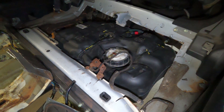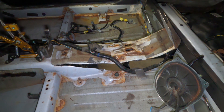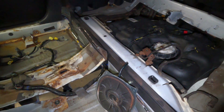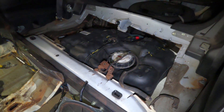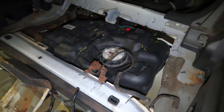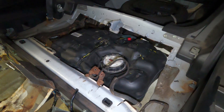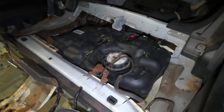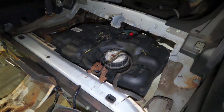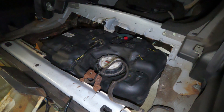For me, I'm okay with that. Realistically, if you are considering doing an all-wheel drive conversion on your RSX, you will already have to do a bunch of sheet metal work because the tunnel needs to be cut in order to clear the drive shaft. In my mind, what's a little bit more sheet metal work to be able to have a nice OEM-style Honda gas tank without having to deal with the hassles of a fuel cell in the back, or making something custom? I know there also is a sheet metal fuel cell that will fit in this space, and that was my backup solution. But I first wanted to completely rule out any OEM gas tank — and what I found, I'm happy with this solution, so I'm going to be using this one.